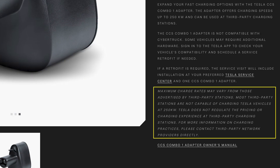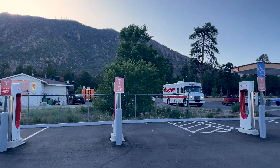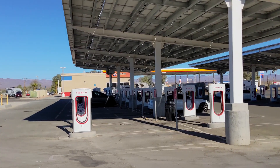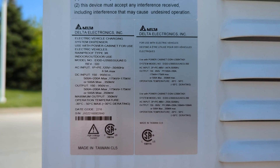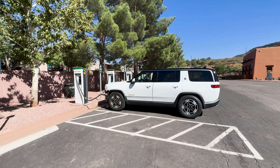That's actually an important note. Tesla built their charging network specifically for Tesla cars, and until recently all Tesla cars were built off a 400-volt architecture. This meant Superchargers have to provide very high amperage to achieve their fast charging. Most chargers outside the Supercharger network support a wide range of voltages but offer lower amperage. So even though the charger we're about to use is labeled as a 350 kW charger, we shouldn't expect it to go much higher than 200 kW. We observed this with other 400-volt vehicles like the Rivian R1T and R1S.